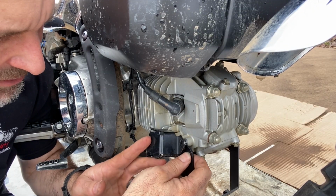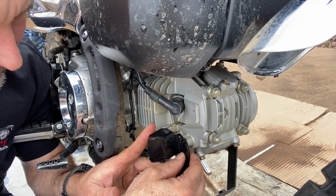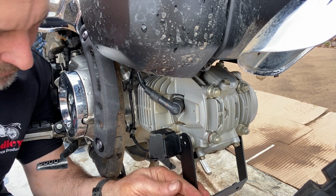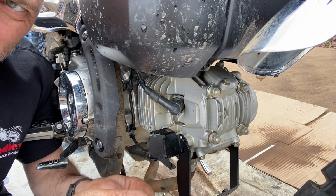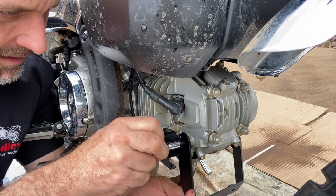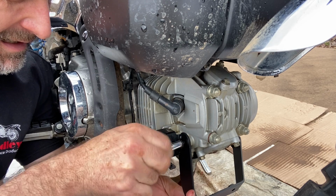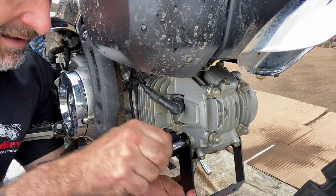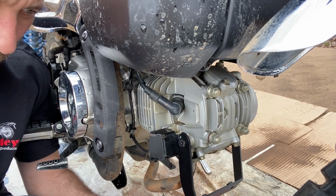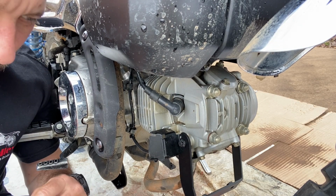As you can see here, it's trying to go on the inside of it. You want it on the outside. So just reline it. It's super easy. There's nothing there, no real pressure. Just run these down finger tight for right now, because you've got to be able to wiggle this to move it to get your bolts to line up on your skid plate.